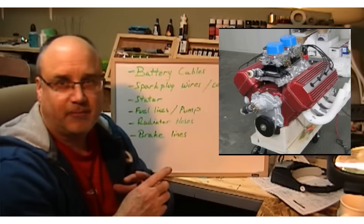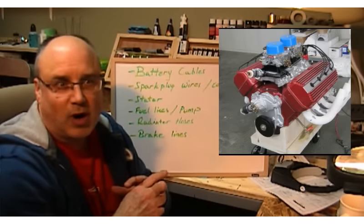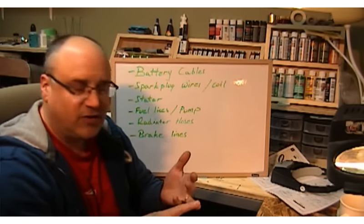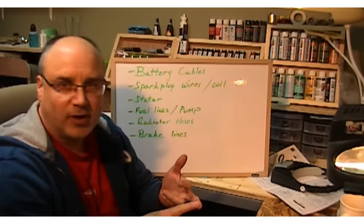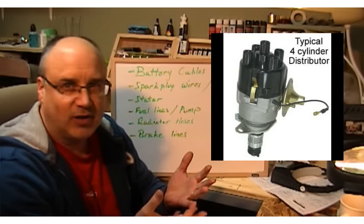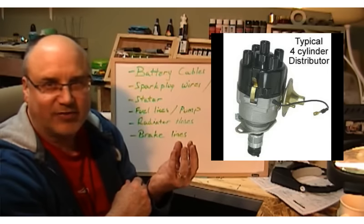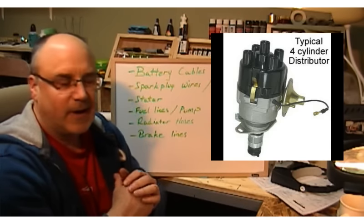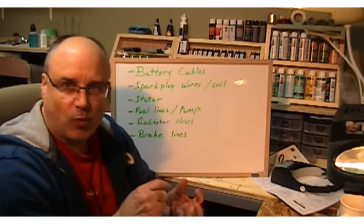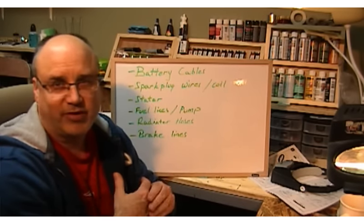You're also going to want to know what it is — is it a six cylinder, an eight cylinder, or a four cylinder? You'll be able to tell by looking at the distributor cap. If the model has any detail at all you'll have the tabs on top of the distributor cap, which always looks like a little round box with little tabs sticking up on top. If it has eight tabs with one in the middle it's an eight cylinder; six tabs with one in the middle it's a six cylinder; four tabs with one in the middle it's a four cylinder.